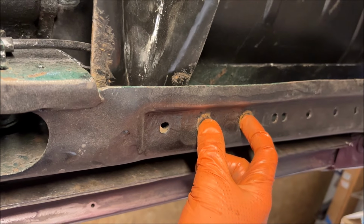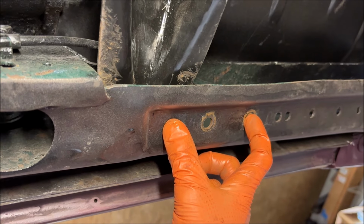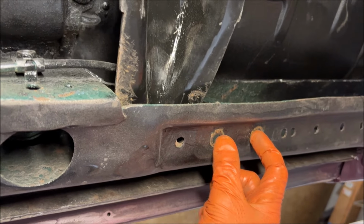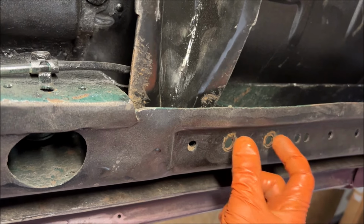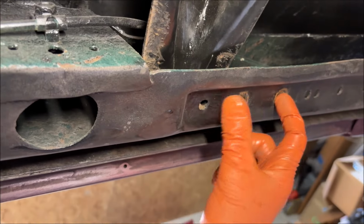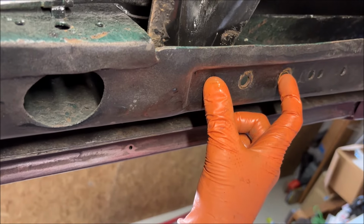And that's where you see that extra wing that I'm adding on. So instead of having just this much, it's going to have this much area, in essence, to clamp to the frame. The reason for that is the way it is stock, this thing's really only taking load in just the downward direction. But when you offset the crossmember, you introduce a torque, and so that's going to help carry the load of that torque across a broader part of the frame.